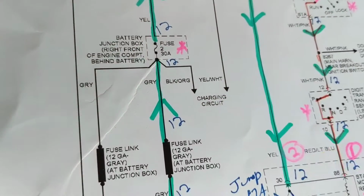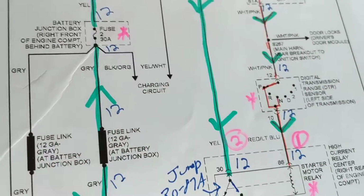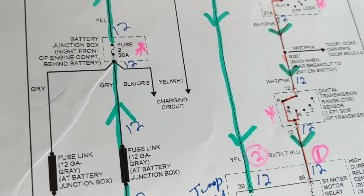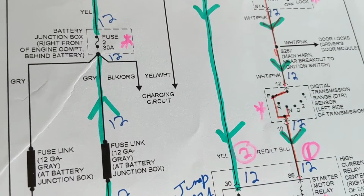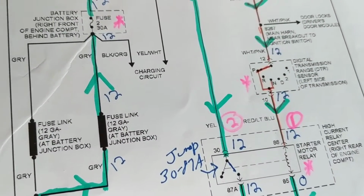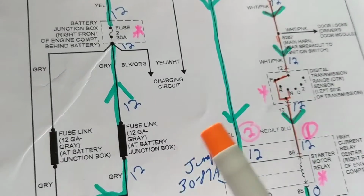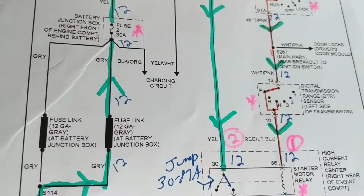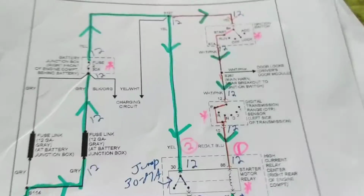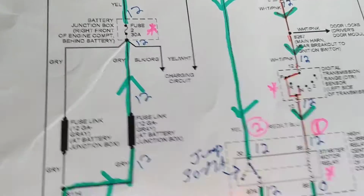Anyway, now let's say it failed. The alternator did not give us the current to replenish. The next time you're going to crank, guess what? Your battery's going to be dead. I go in the morning, going to work, and I start the car, and I say, okay, the battery is dead. I measure the voltage first thing, right? Or I have a gauge in my instrument panel, and I look and I say, wow, 10.6 volts, not good. Can't crank with that, right?